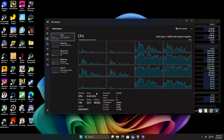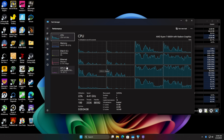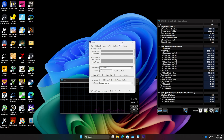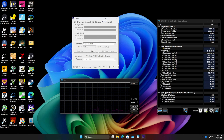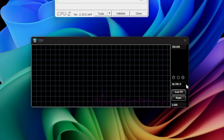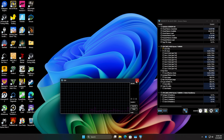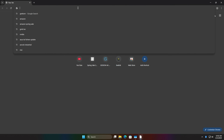Moving into Windows 11, we've got the AMD Ryzen 7 6800H, eight cores, 16 threads, 32GB of DDR5, and the 680M iGPU with up to 8GB of dedicated VRAM from the BIOS. In performance mode, when stressed you'll see it jump up to 61–64 watts before settling down to a sustained 54 watts — more than enough for a mini PC like this. If you want to use this as an everyday desktop machine, this AMD APU offers plenty of power for most everyday tasks.